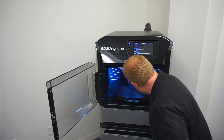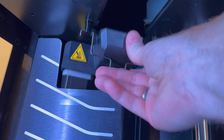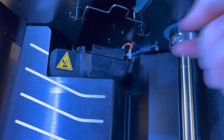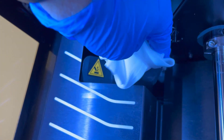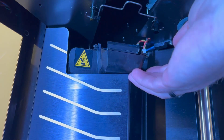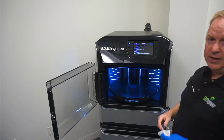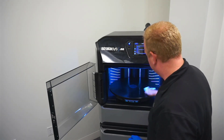Now for the last side of the cleaning cloth, reach in and flip open the wire locking tab. You'll see the little squeegee in there — that's what you want to clean, just the front and top of that. Give it a little cleaning so that it doesn't drag any old material onto the print heads while they're being cleaned.